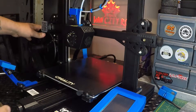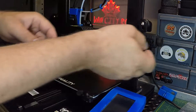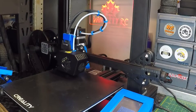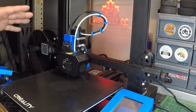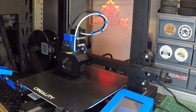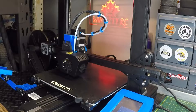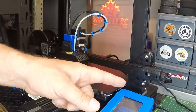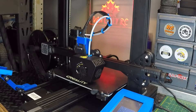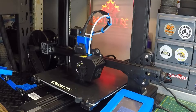No tools, didn't have to take anything apart. Tighten it up a bit here — feels pretty good. Now we've got that X-axis belt changed out. I'm just running a bed level to keep an eye on the belt and make sure it's running smoothly and not binding. So far looking good. I think that was an easy enough repair — definitely easier than what I saw on the Creality video. The only thing we needed to remove off the printer was the tensioner. Everything else was able to stay assembled, we just fed that belt through, and now it looks good, guys.